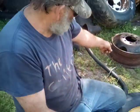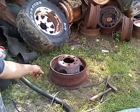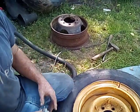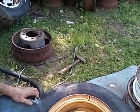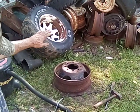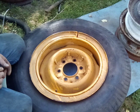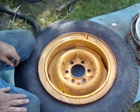It's hard to get that tire off that rim. I can take a grinder and cut it off, but then I wouldn't be able to use the tire — I'd ruin it. If you want a safe tire, you're going to have to get tire spoons and work it off. That's a drop center rim — you can push it way down and get that bead to drop in the center. You can get that off there pretty easy once you get it broke down.